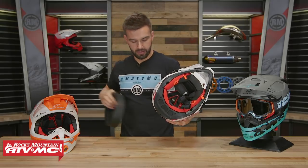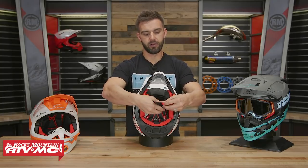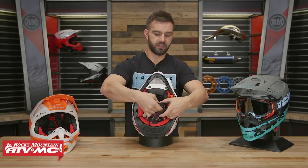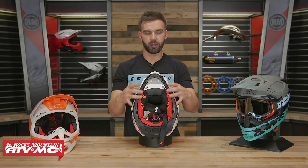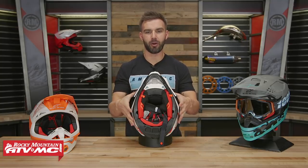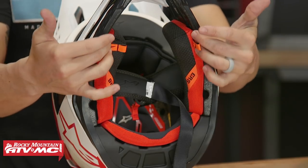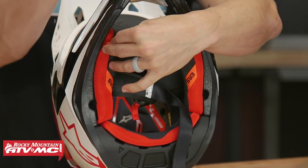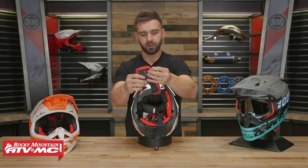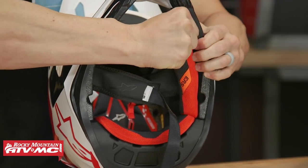That's the outside — now let's dive in and talk about the inside, because there are a lot of cool features built in. Undoing the chin strap here — just your traditional D-ring, with a snap holding it in place. First thing I want to point out is the emergency cheek pad removal system. The purpose is to get the cheek pads out as easily as possible when trying to get the helmet off the rider's head. You have these tabs — they'll be pushed up slightly in the cheek pads when you get the helmet out of the box. You just grab on and pull down and away from the rider's face — down and out. They pop out pretty easily.